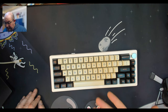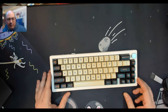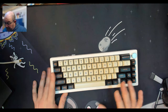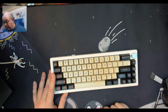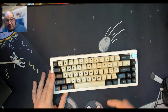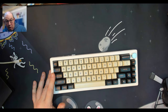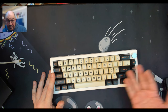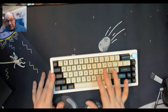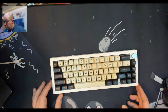But when I was like, all right, I got to find out, I mean, who can pass up a $21 keyboard? I mean, this will probably end up going to a friend or family member because everyone's really enjoying this keyboard. So that plastic, whether it be PET or LDPE, acts the same as a low pass filter. It would sound even a little bit better if I did a Tempest tape mod, but just that plastic alone takes this keyboard to a whole other level.